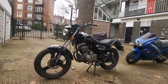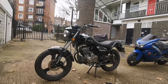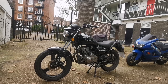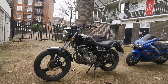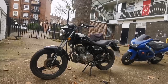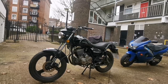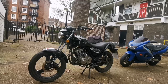The really annoying thing is the throttle response feels normal. And the choke is up, so the choke is on, so it's restricting air. I could check the air filter in case that splits or anything, but it shouldn't have. I'm going to let it warm up a couple of minutes off camera. I won't do any work off camera, but I might pop that panel off, just have a quick look at the air filter. Not that that should make that much difference. This bike should run without an air filter. But I definitely want to get it up to temperature and see what's going on.